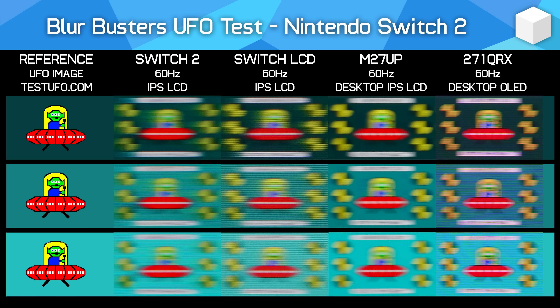At 60Hz due to sample-and-hold motion blur, it's very difficult to get a clear image even with extremely fast response times like you'd get on an OLED. On the right side of this image you'll see a desktop OLED monitor running at 60Hz — it's still pretty blurry, but the difference in clarity between the OLED and the Switch 2 is night and day. On the OLED you can begin to see that the white bar actually contains text, there's more definition in the UFO, you can see hints of vertical lines in the red body, the joystick in the cockpit, and there is practically no blur trail behind the UFO. I don't own a Switch OLED to test directly, but I would assume it gets reasonably close based on other OLED testing I've done.